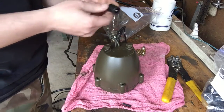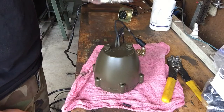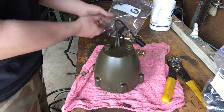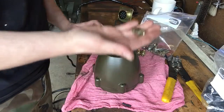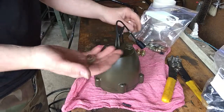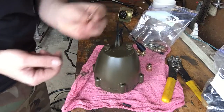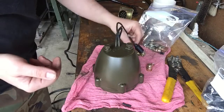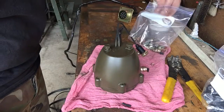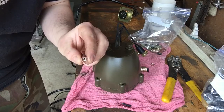It's actually not as hard as you think. I thought I was going to have to splice it and all this, but it really doesn't come to that. What you need is just regular Packard connectors, new or used - you can get them at Vintage Power Wagon, there are other places that have them too. There are three parts: you got this part, this little ring, this rubber connector, and then there's also a sort of two-way insulator - that's what the pins connect together on.